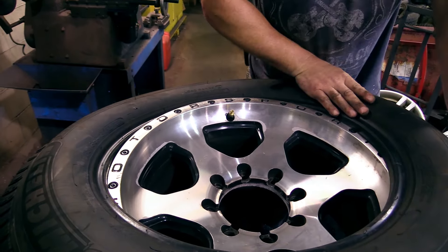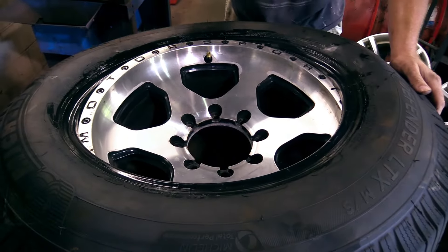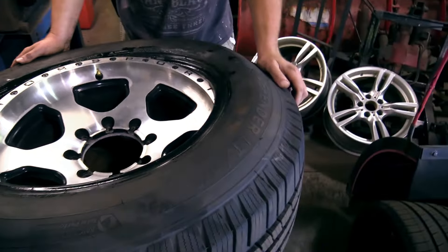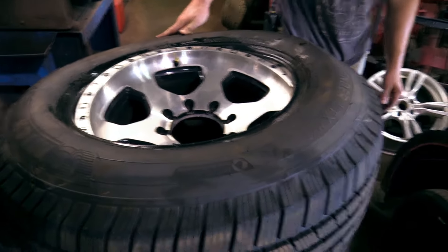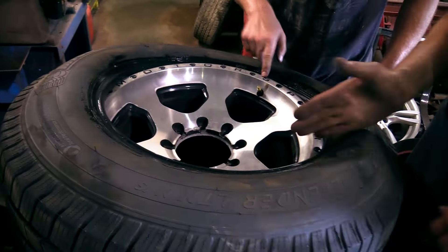Now I've got to make sure I put my tire back on — we'll get it seated first. Nice thing about these aluminum rims is I should be able to just push this on. The first bead I can push on. When I do these TPMS sensors, where do I put it? You want to put this back in here — you don't want that bead right on. You want this up in here — like there. Right there, and then start.